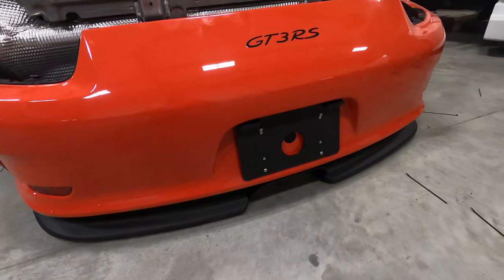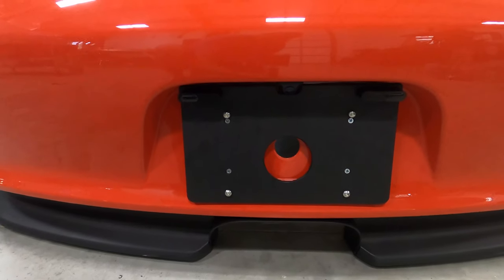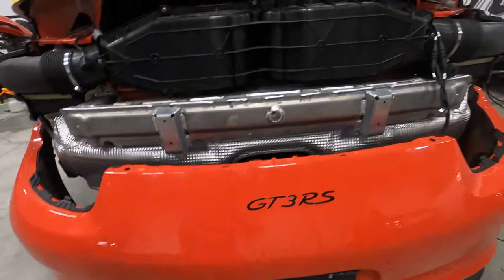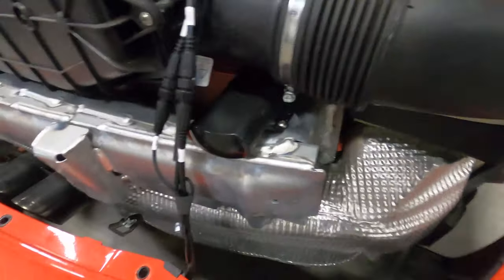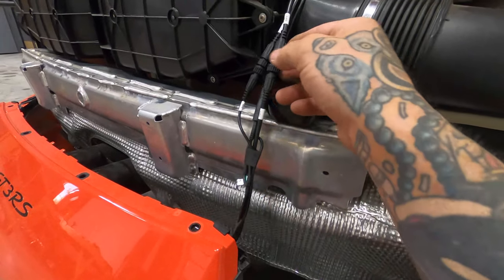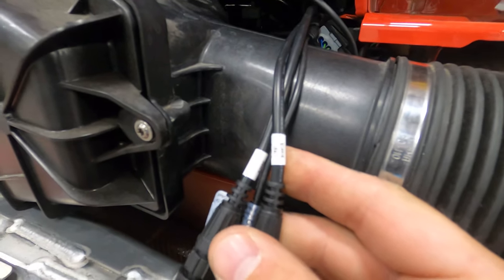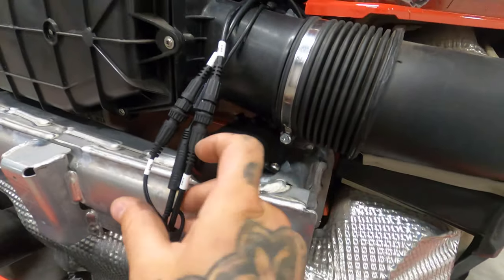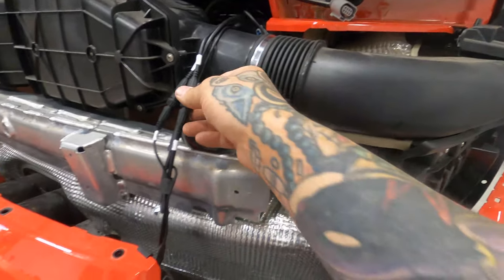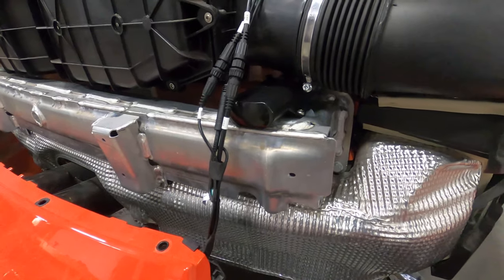So it definitely makes it a little easier having the parts pre-manufactured so that we can work off the vehicle. And then we still get access to the tow hook in the back, so super cool. Harnesses here, this is kind of how we prep them. So this is gonna be our backup camera. This is also the rear TX, the rear RX sensor. Again, they are all labeled, so if this thing ever goes in for service or anything, this is the loop here, right? So we put a service loop back here, they pull the bumper, everything's labeled appropriately and dressed like factory harnessing, so that's the way it should be.